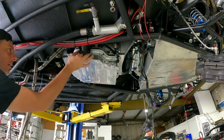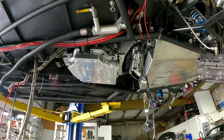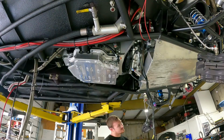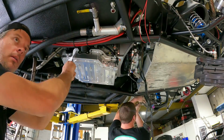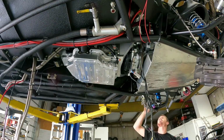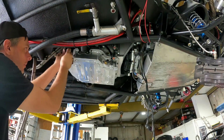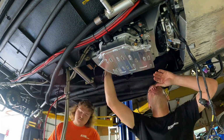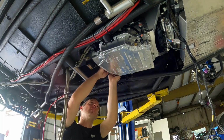All right. This time lapse, we're gonna have the music going in the background. One of our tunes we use a lot on our time lapses. But yeah, figured I'd do that along with the talking over the time lapse thing again. So right now, just finishing bolting the transmission pan back on. Got to bolt the shifter cable bracket over on the other side still. Reinstall the fittings from the dump valve right there, along with the temperature sensor. And then Drew's kind of coming in, doing some mocking up on the transmission crossmember. I'm kind of giving him some pointers along the way.